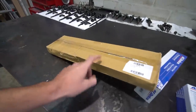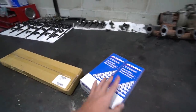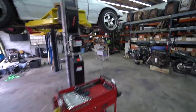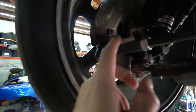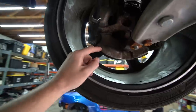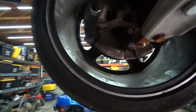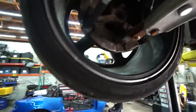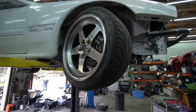I've got a set of adjustable arms to replace those. Got some nice new tie rod ends to replace the ones on the car, because I believe the ones on the car are for like an S13 or something — they don't look right. You can see how they're straight; the other ones arc up to prevent bump steer. I've got a set of modern knuckles, but supposedly they don't fit right, so I'm either going to mod these knuckles or try to see if I can make those work. That really needs to be handled because that's all the angle we've got right now, and this is a drift car — that is not enough.